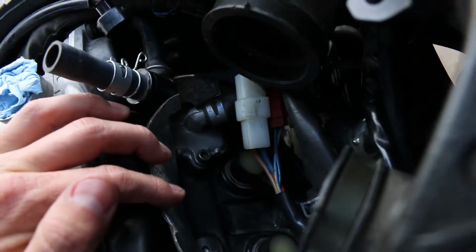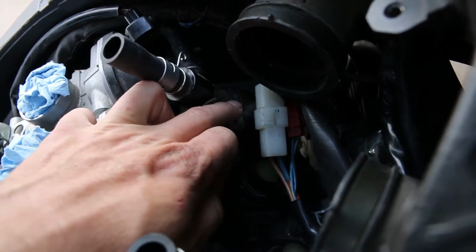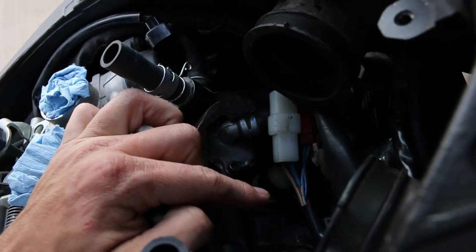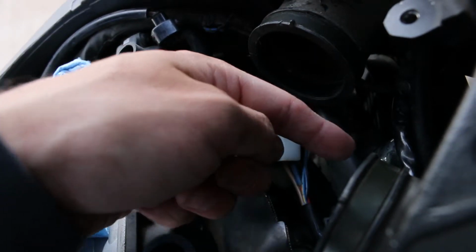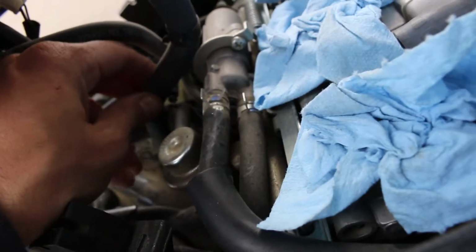Okay. Then down here on our pair valves, I'm gonna take them off. I gotta remove the reeds from inside. This hose right here will tee together just like it does right now, and then on that one part of the T, I'll have another line that runs out here, runs underneath this side of the motor, and ties into the crankcase vent right here.